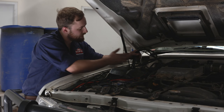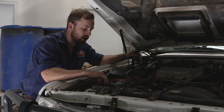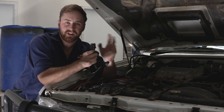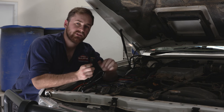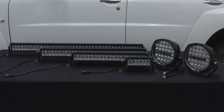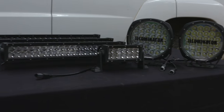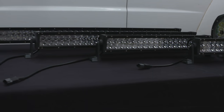Coming from your relay you're going to have three main wiring runs. First up, grab the one which has the two male Deutsch plugs — these will suit each of your LED driving lights. If you have a harness to suit an LED light bar, it'll just have the one plug. At 4WD Supercenter our entire range of light bars and driving lights are already fitted with a female Deutsch plug, so you could even connect two light bars to a driving light harness if you wanted.